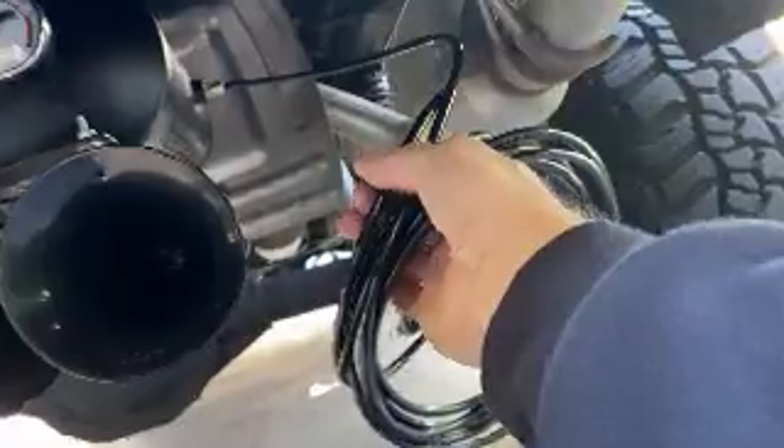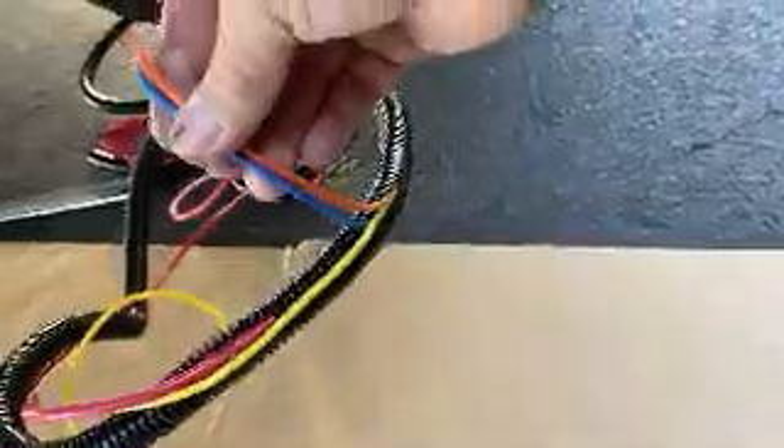This will be my spare air — I'm going to put an air chuck somewhere so if I want compressed air, I can easily just plug into that. And then you've got all your wiring that I did last night, where I've got my basic ground connected to both solenoids, the compressor, and everything else that needs to go there. This wire will run against the frame all the way up to the front of the vehicle for the battery. Then I've got my three switch wires right here and it should be good to go. I haven't tested it yet because I'm scared to death to test it in my neighborhood, but it's going to be tested soon.